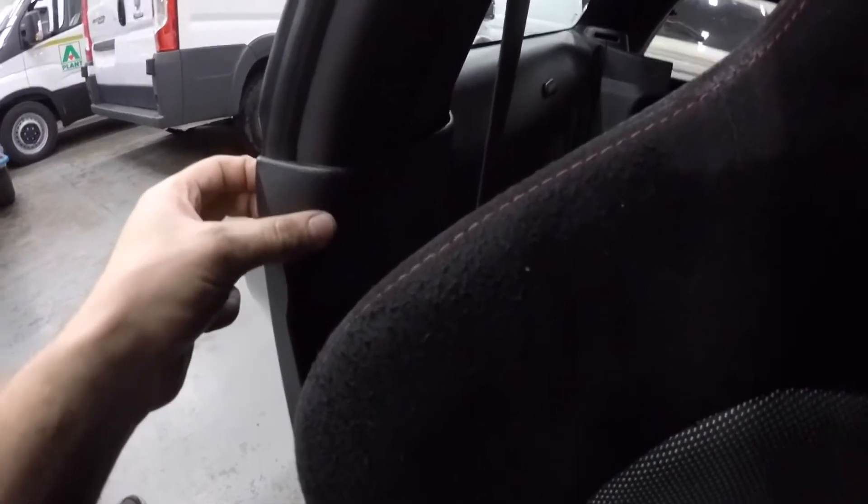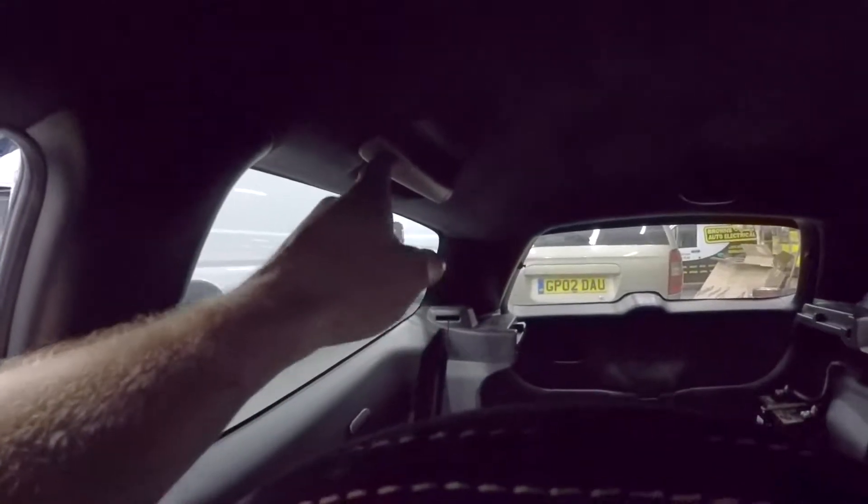It's easier if you take this off. I've got the back seats out, so you take your actual belt off here — they're two 14mms — and you lift this corner up and pop it off and then you can slide that out. Just pop the little cap out there and stick them in.